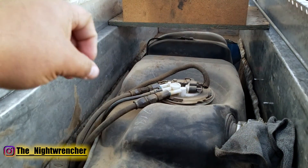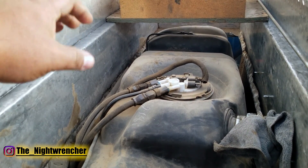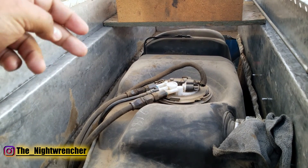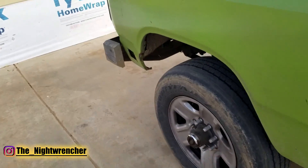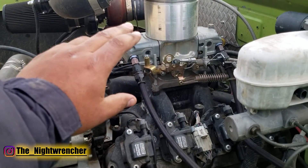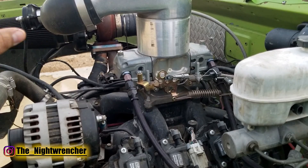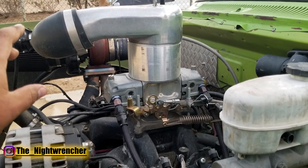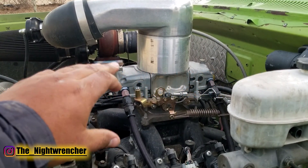Why would you need to install a fuel pump like this? There are a couple of reasons. Number one, EFI style fuel pumps can put out a ton of fuel. Some mechanical fuel pumps can also put out a large amount, but the second thing you need is pressure. EFI style fuel pumps can put out 40 to 60 psi no problem. When you decide what boost you want to run — and chances are the answer is all of it — you have to make sure the fuel pressure matches the boost pressure applied to the carburetor. If your base fuel pressure is 6 psi and you're running 20 pounds of boost, you have to add 6 psi of fuel pressure plus 20 pounds of boost, and that's the fuel pressure you need at the carburetor.